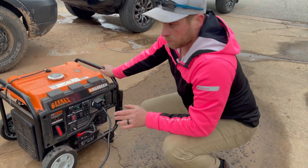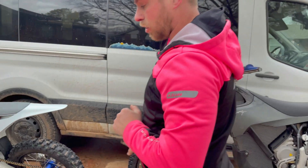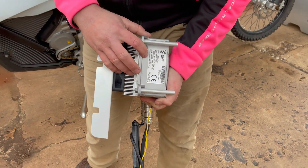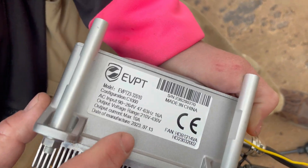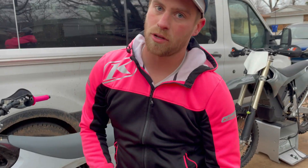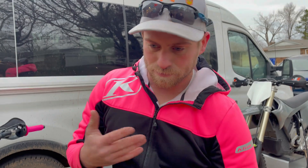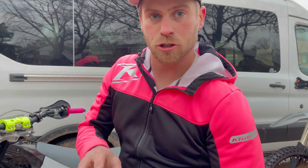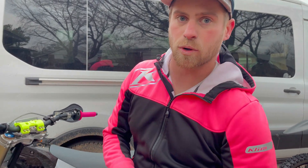Before I fire all of these up, I'm going to show you the charger. It's an Elcon 3300 watt charger. You have a max input of 16 amps and a max output of 10 amps. So, even though you have 30 amp 110 plugs, this will not take more than 16 amps. They say it won't do more than 1600 watts on 110, but we've seen high 1700s and 1800 watts when it's at that peak power — it really will take a lot of juice. On your screen when charging, when it says you can scroll up to 10 amps, this is what it's talking about.